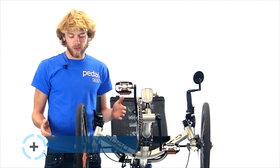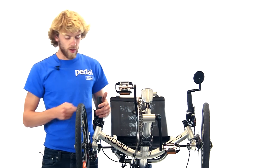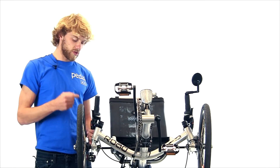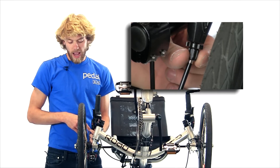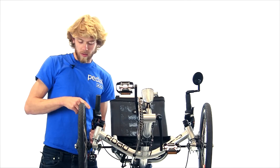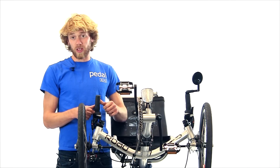First step on making sure your brakes are tuned is making sure you have proper cable tension. I like to put the brake lever halfway between neutral position and the handlebar. To adjust this tension you can use the barrel adjuster located on either the brake lever or the caliper itself. There are two screws: a lock nut and the actual adjustment screw. To add tension, unscrew both the lock nut and the barrel adjuster screw itself, then re-tighten down that lock nut and make sure it's tight. That will adjust your cable tension. You want your brake lever to be approximately halfway between neutral and the handlebar.